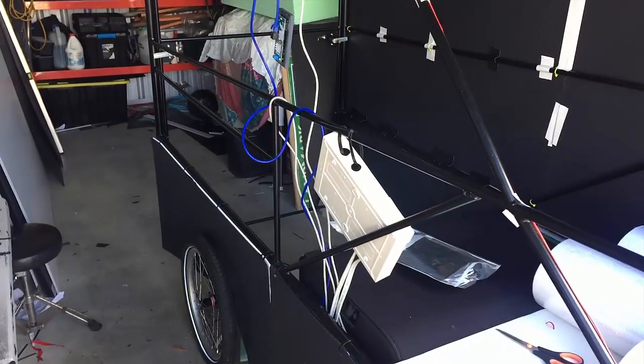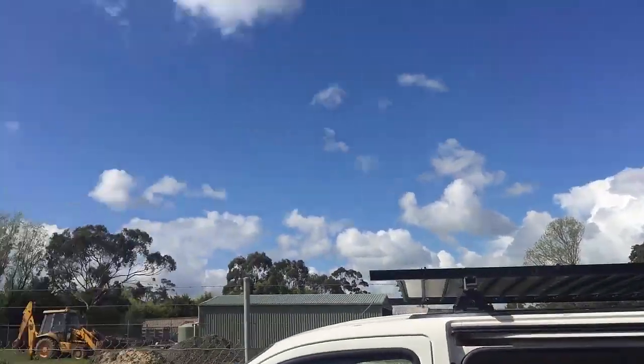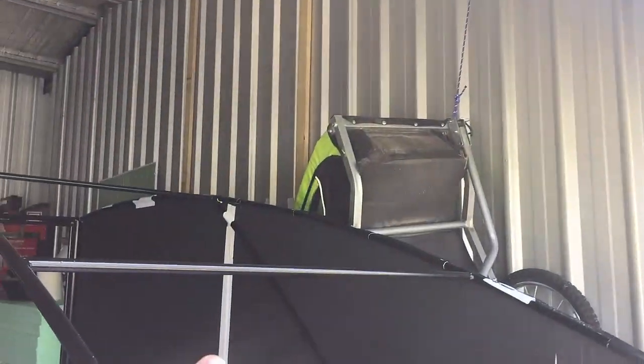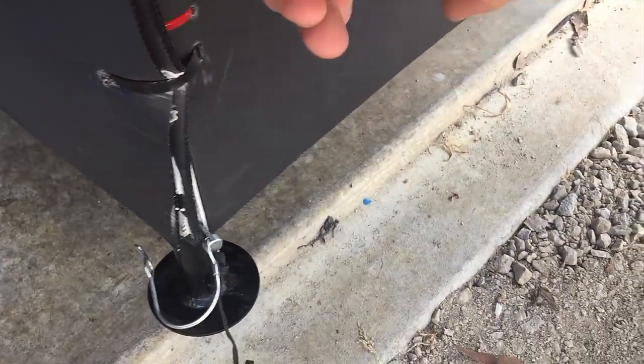Once it's totally skinned on the outside and I've put the roof on, I've got the solar panel up on my camper van — that'll come down and go. So I've got an 8mm piece of core flute to run along this roof, and then I'll Sikaflex that solar panel onto there and bring the leads down through this wall and into the electrical box.